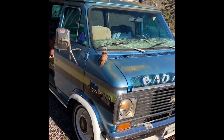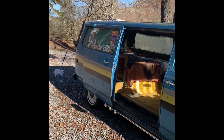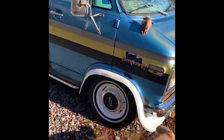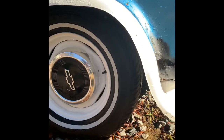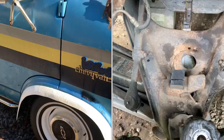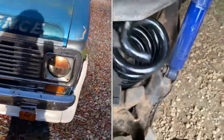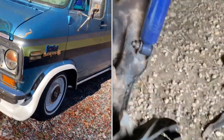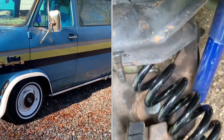I've had this van about a year and a half and drive it everywhere. How I lowered it is I bought new G20 springs — I think they were AC Delco springs — and I cut two and a quarter rounds out of them to lower the front. I'll put up some pictures of when I first got it and what it used to look like.